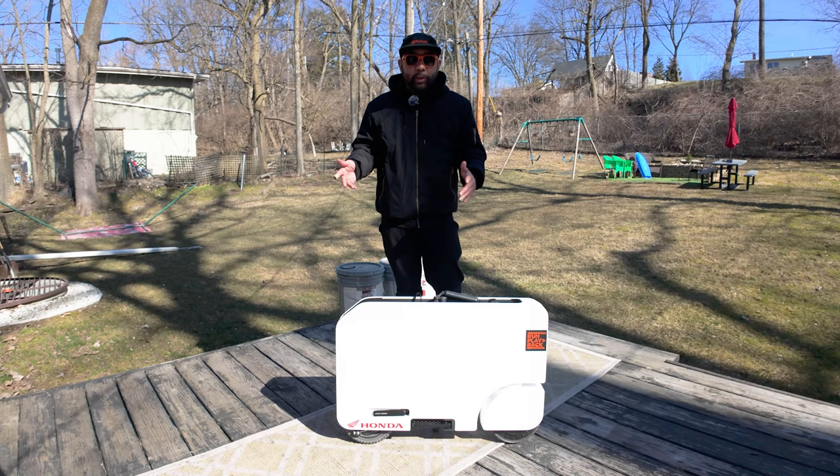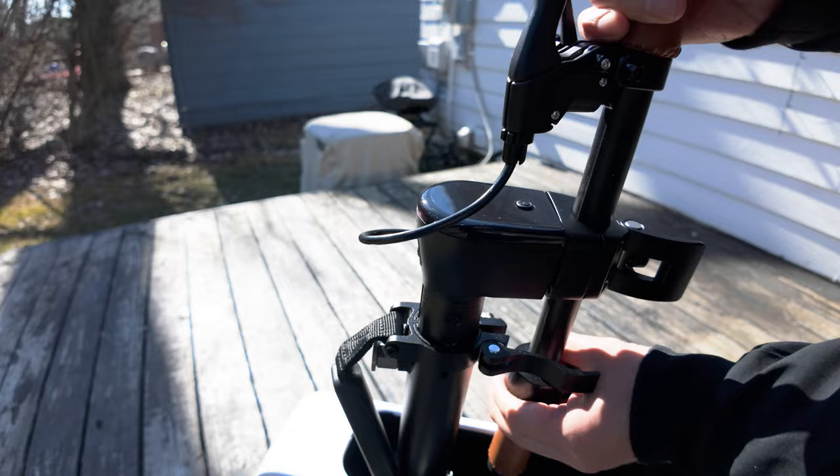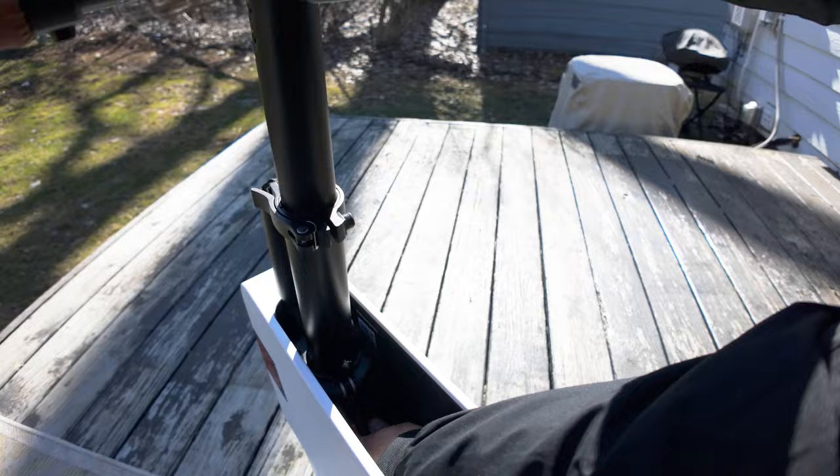After some practice, it's a lot easier to fold and unfold the Honda Moto Compacto. To unfold it, first you bring the handlebars up. There's a switch in the back — press that down and lift it up. Open the latch up here, pull the bars until it clicks, then close it. Then open the upper latch and rotate the bars to the left, snap in the latch, and then secure the bottom latch by lifting it up and locking it in.